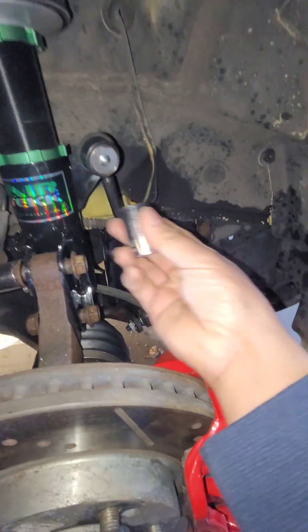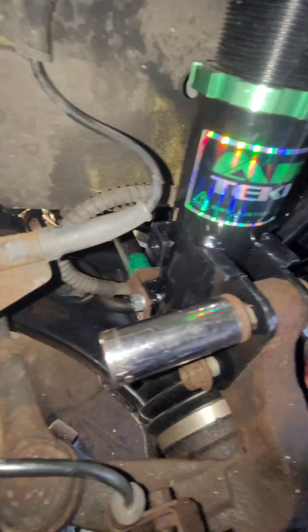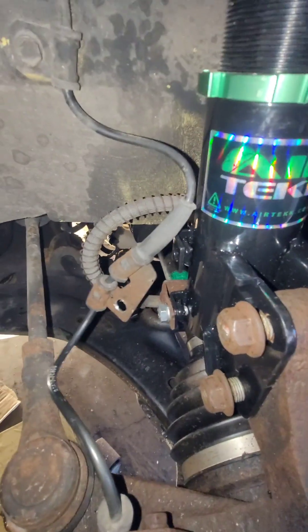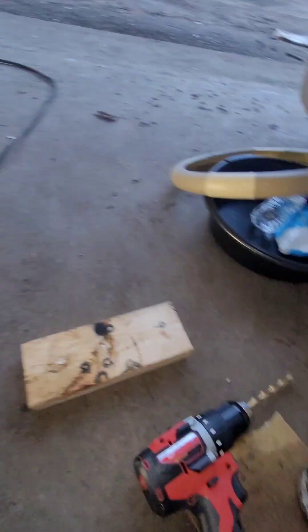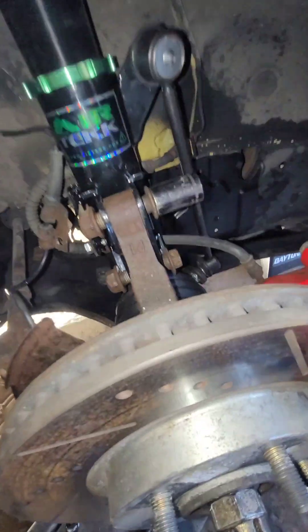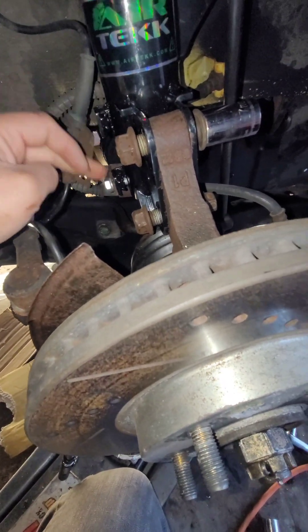This side is a 17. You got to disconnect your brake line or speed sensor — I believe this is your brake line right here, goes to the back. I just went ahead and got a new nut and washer for it, and then the top one I got a new bolt and washer as well. But you have to make the hole bigger, so I just used a drill bit. Right here is the new bolt and washer I got, so now it'll fit in there. Making the hole bigger — it'll go there because on the old one the two holes were different sizes.